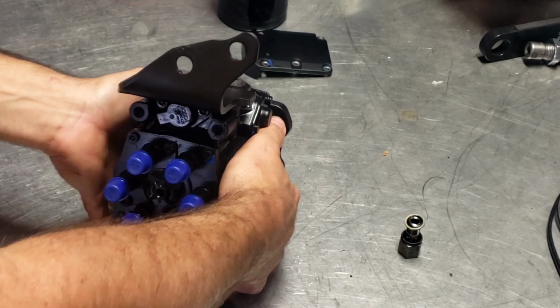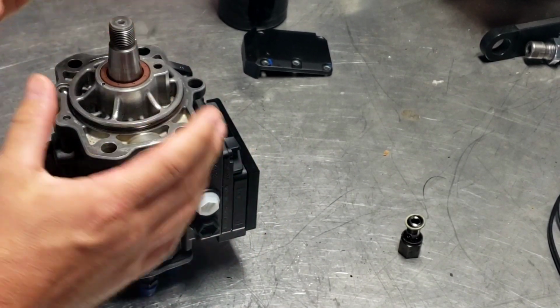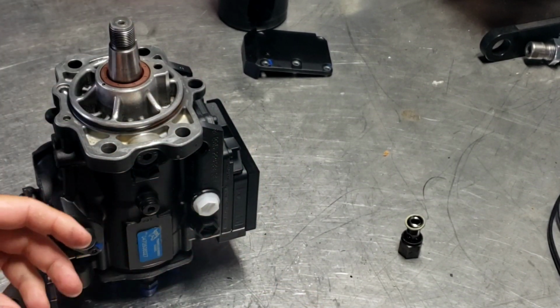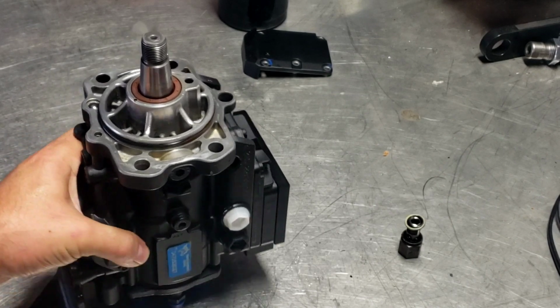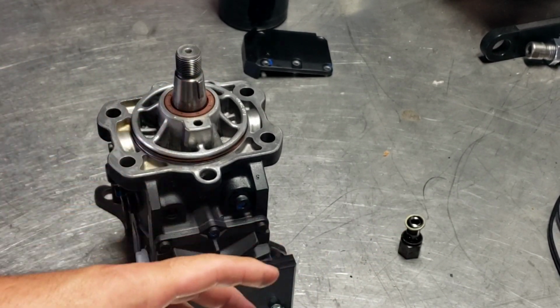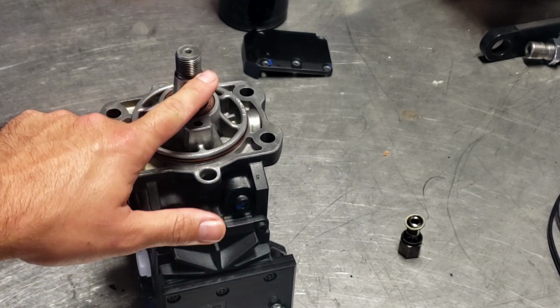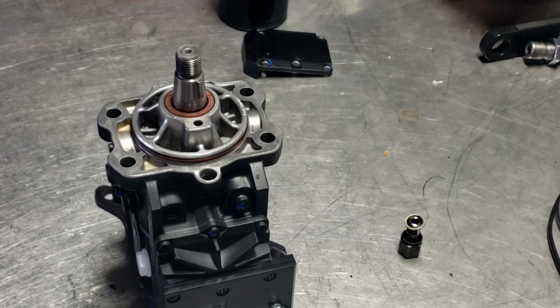If I would have done it properly, when I took the old pump out, I could have lined the keyways up. Let's see if you can see that keyway. I could have lined the keyway up here as soon as I took it out, but instead I ended up rotating the old one over, so I'm going to have to line it up a different way. We just want to make sure that when we put it in there, it is lined up perfectly, or we'll just push this keyway all the way out. So the next video will be hopefully it going on the truck.